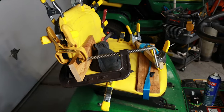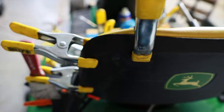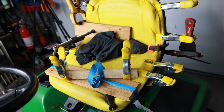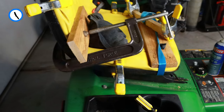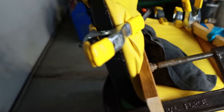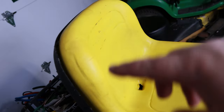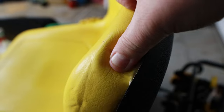I went ahead and put a few more clamps around this thing — might look like overkill, but the better you can clamp it on there and keep it tight against that plastic base, the better chance it has to actually stick and stay in place. We'll let that set up overnight. It's been about 14 to 15 hours now — I'll start pulling these clamps off to see how this looks. The longer you can let this set up, the better it's going to be. Once you get all the clamps off, let that foam expand out a little bit — it pushes the vinyl out so you get rid of all the creases. You can see that is very well attached, with a nice clean edge around the top. No way that's going to pull away from that.